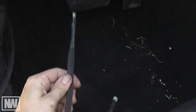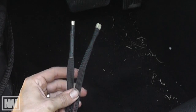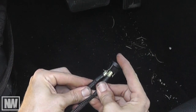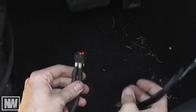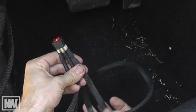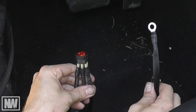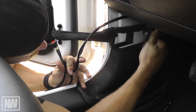With your battery wire and compressor wire in the cab, you can now hook up your switch. The battery wire goes in the center terminal of the switch. The compressor wire goes to the other silver terminal of the switch. The provided ground harness goes to the brass colored terminal of the switch. The eyelet of the ground harness then goes to any ground stud near your desired switch mounting location. I chose the driver's side grounding stud near the OBD2 port.